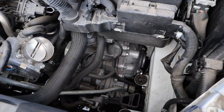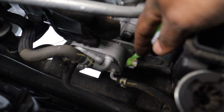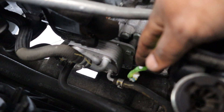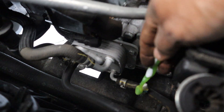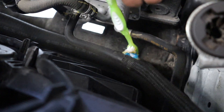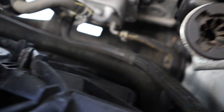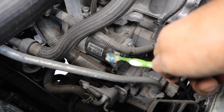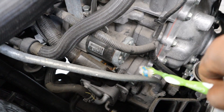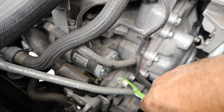With the air intake out of the way, we've got wide access to the transmission — which everyone loves to hate. In an effort to increase reliability, there is a transmission cooler here that exchanges automatic transmission fluid with coolant coming in from the radiator via coolant hoses. One thing I don't like is how loose these hoses are, dangling right next to the fan — they couldn't find a clip. Also hanging out in front of the transmission is the starter, which is pretty easy to get to. With start-stop systems, starters will wear out a lot faster.